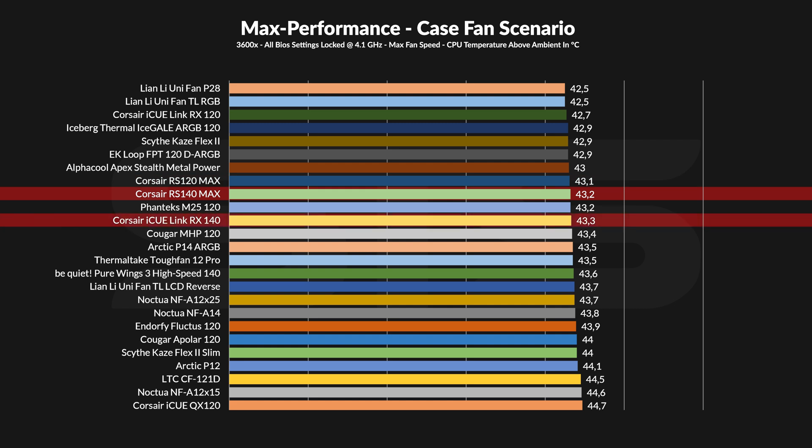Compared to the RX-140 fan, it became really interesting — even if the RS-140 Max is spinning slightly slower, it is pushing slightly more air. What makes this interesting is still the loss of static pressure, because the Max fans are pushing everything a lot softer, which isn't noticeable at all in the benchmark results. But if we ignore the spec sheet values, the 30mm thick RS-140 Max performs like a charm. It's not a chart-topper, but at 43.2°C above ambient it lands in the upper range, outperforming a bunch of other important fans — and it does so at only 1600 RPM.